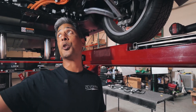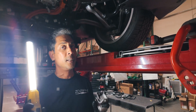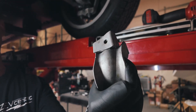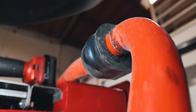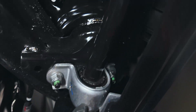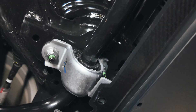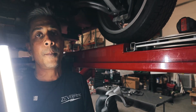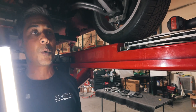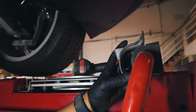We were about to install this Eibach bar on Tim's 2024 Model 3 Performance, but then we realized that the sway bar mount is actually different. Notice — this is the older Model 3 Performance, the older platform mount. It actually has a little hump right there, and that hump is also right here in the bushing on both the OEM bar as well as this poly bushing from Eibach. Now take a look at the 2024 Model 3 Performance sway bar mount — there is no hump. So those of you who may want to upgrade your sway bars to the ones from the older platform, you will need to buy a set of these mounts from Tesla or from us. We'll start supplying these with the sway bar for you guys.